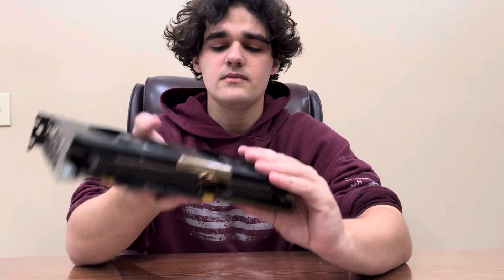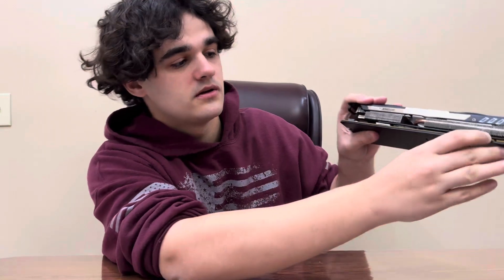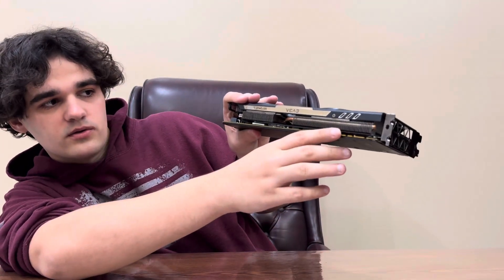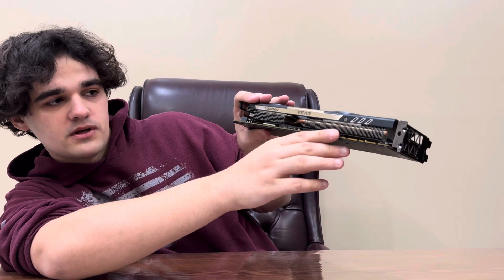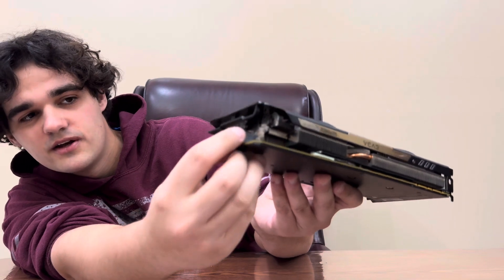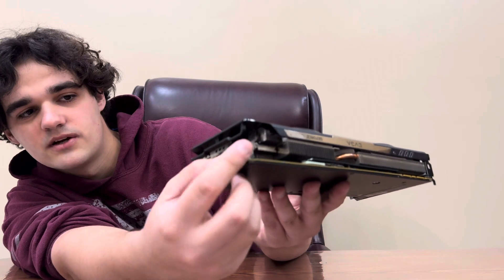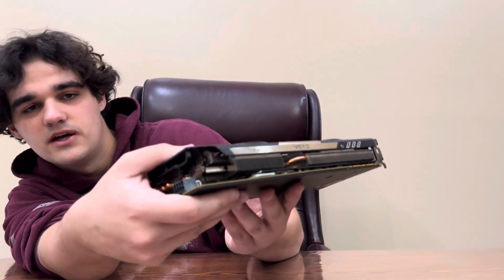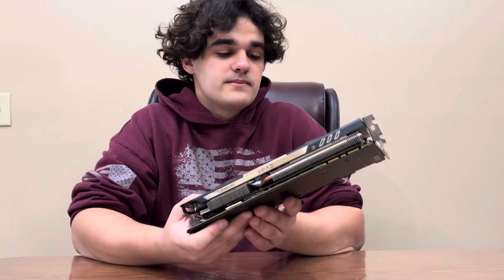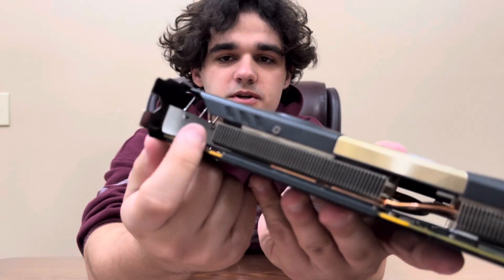You can see I've sanded out '770' here — this is the P40 now. I've got the metal plate here cooling the VRAM as well, and I've cut this out — you can see the carnage here — to allow the heat sink to go over the eight-pin EPS connector without touching it, making sure it's not touching those exposed metal pins.